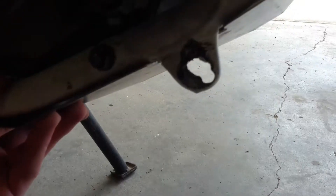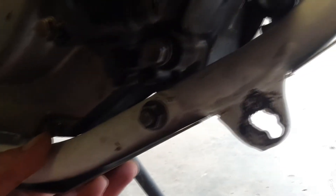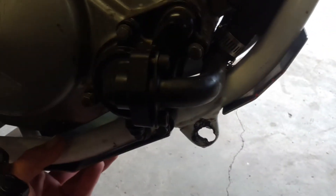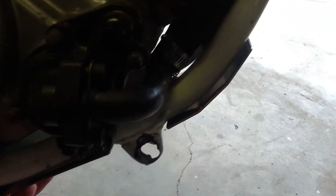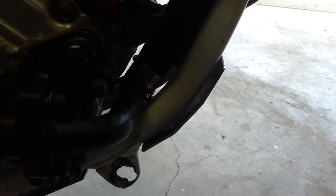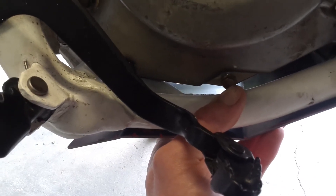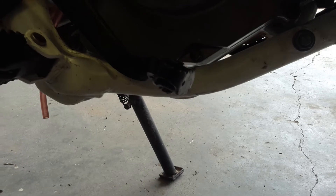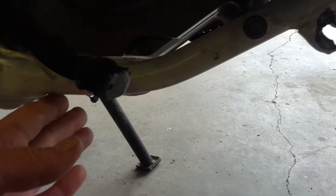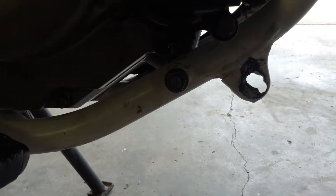I've decided to leave it as is. For a mounting solution, I'm going to come off of that engine mount point where the nut comes through the frame. I'll just add a couple of little metal tabs on both sides of the bash plate and it'll hold it in the middle. Normally bash plates have at least four mounting points, but I'm not going to be hitting the bash plate right at the top because that's where the exhaust hangs — if I'm hitting that part, my exhaust has probably already turned into a pancake. The rest of the bash plate is pressed up against the frame so there shouldn't be any flapping. If skidding backwards over something tries to fold it down, I'll just cut the bash plate at this lump here and it will be recessed into the shape of the frame with no way to catch it. That's enough justification — I'm just going to get it done now.